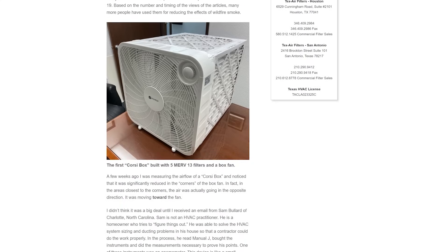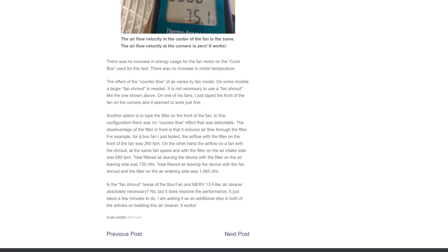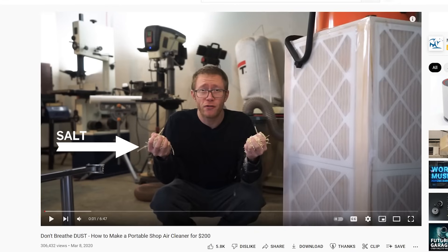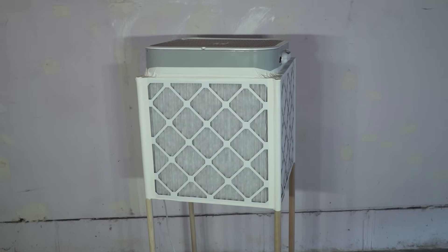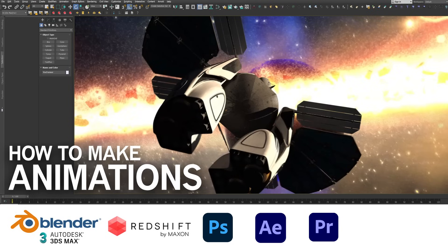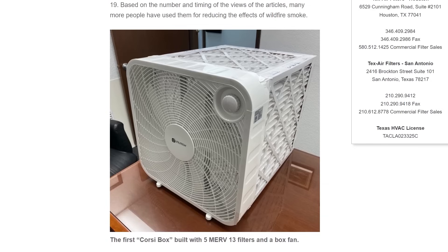As I understand the fan shroud or ducted concept, you want the divider to be in line with the fan blades to prevent unwanted wind vortices from forming around the edges. However, if the fan shroud is out in front of the blades, there is nothing to prevent those vortices from forming inside the fan case — I think that is why my tests with and without the shroud yielded the same result. I only found one article where air speeds were thoroughly tested, written by the Dean of Engineering at UC Davis, Jim Rosenthal — whose last name you may recognize because the Corsi Rosenthal box is named after him. His design uses 2-inch filters, which would further improve airflow to around the 1000 CFM mark that he achieved in his article.